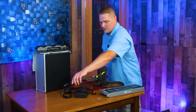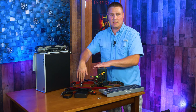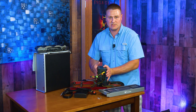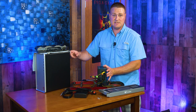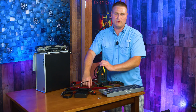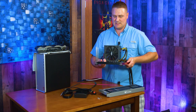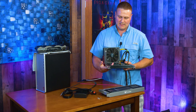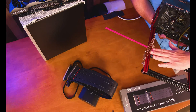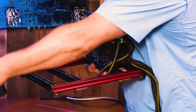One important thing before I jump in: the series of how you're gonna turn things on. Once you have your GPU mounted in this test bench, you want to make sure this power supply is turned on before you turn this PC on. That's very important. If you want me to go over the actual building of this test bench, I can — it's just some plexiglass and standoff screws.